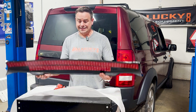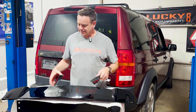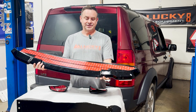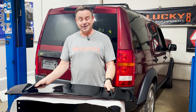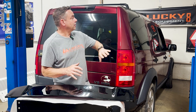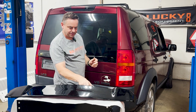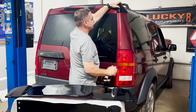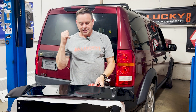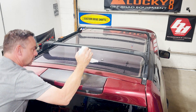This kit's a pretty simple kit, made of plastic. We've got three pieces, and they both have 3M double-sided sticky tape on it. It's going to be very easy to install. I'm going to get some cleaning alcohol and clean this whole entire area, clean these end caps — because that's where these little pieces go, like so, to help finish the spoiler look. Let me get that cleaned up and then we'll just start sticking this stuff on.